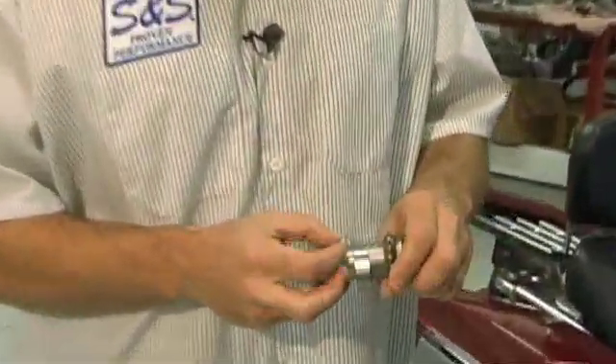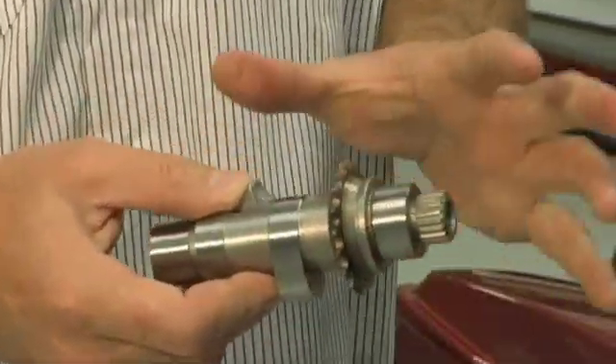What it's doing is taking the valve off the valve seat just enough to help out, so the compression leaks a little bit, but not enough to keep it from starting. That's absolutely correct. Then as soon as the bike pops off and starts, this counter-weighted balance over here lifts the trigger out of the way, and the bike runs as normal.